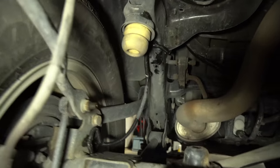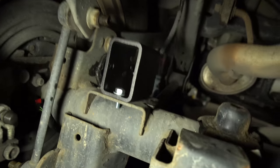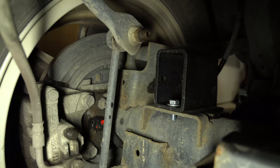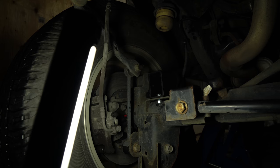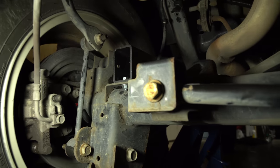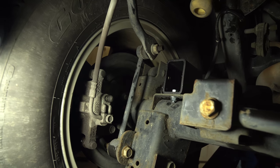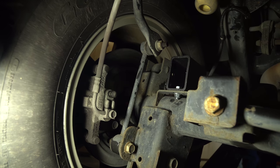Where you see that yellow piece, directly below it is the old bump stop. There are two holes in it — one bolt through each side. Nice and silver like that, then put the washer and nut on. You'll see two bolt positions: one for a two-inch lift and this one for three-inch. Once you have that lined up — the shaft of the screw goes downward so the nut screws on from the bottom. Put a half-inch box wrench on the bottom and ratchet from the top. I tightened it as tight as it would go with one hand. It's a nylock-style nut so it's going to lock itself. It's a bump stop — it'll hold in there.